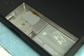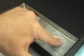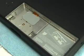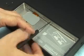Once you have the battery bay open, you need to actually remove this little L-shaped door. Apple provides instructions right here on the right side showing you how to do so. There are three Phillips screws that you need to remove — those are Phillips P0 screws, and they're quite small.